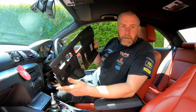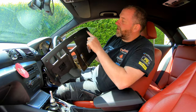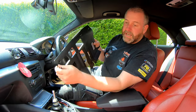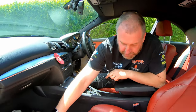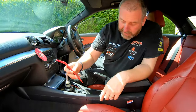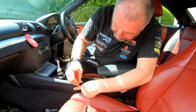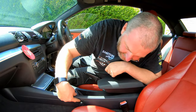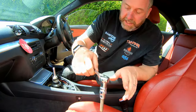Okay, there we go. Driver side removed, and as you can see, there's three screw holes, and there's the hole for the little plastic push pin. Other than that, it comes out exactly the same way as the passenger side one does. Right then, next, the last little bit of trim to remove is this little cover just here on the side, and it uncovers another T20 screw.